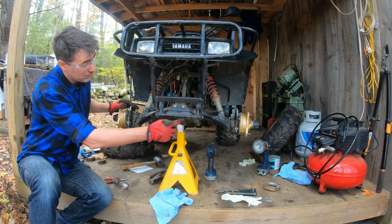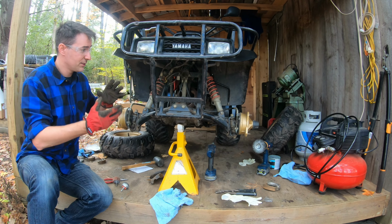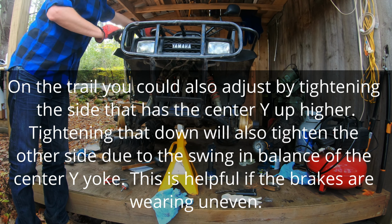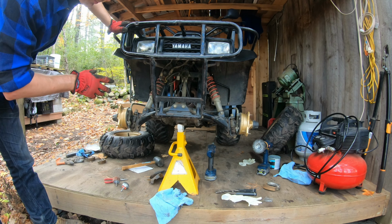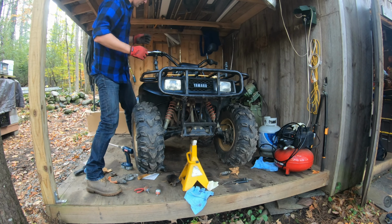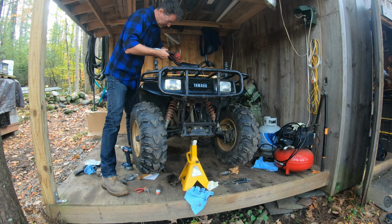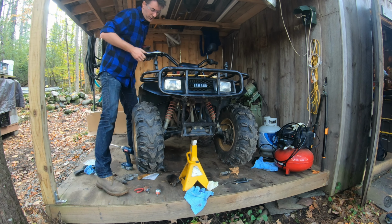Take up the slack in the cable. If the slack is all gone, it should pull the same. And again, just the way I've done it, it's in reverse. I'm gonna put the wheels back on now so I can actually spin and see how well they lock up, and I'll do my final adjustment up top. So now any adjustment I want, I can do up here. A lot of good pull in those brakes now.